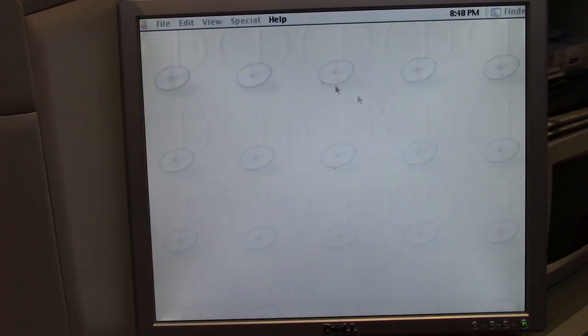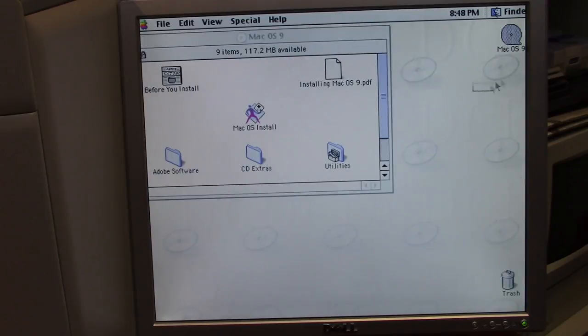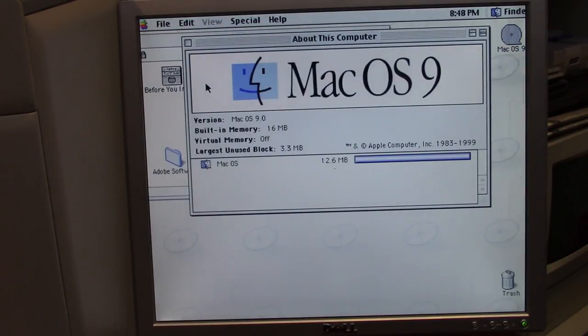Okay. Clock set to bad time, whatever. Usually if there was a hard drive, I think it would show up on the desktop here, but maybe there just is no hard drive in this thing. All right, well, that answers that question. We need at least 32 megs of RAM to install macOS 9, which we don't have. So how much RAM do we got? 16 megabytes. Okay, so...